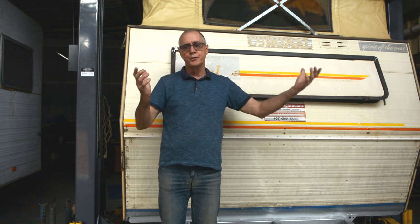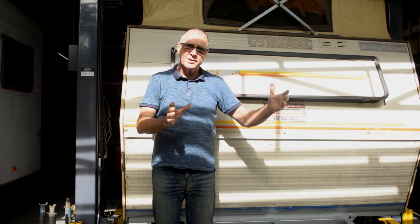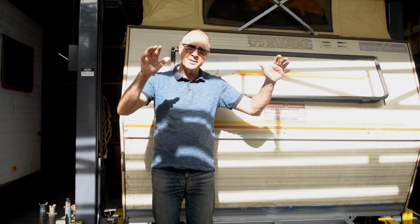In this episode we're going to look at the suspension. We'd like to put a bigger wheel in to get the van off the ground a little more for extra ground clearance. We also want to upgrade the suspension to increase the load carrying capacity up to two ton — that's going to involve a new axle, new set of springs, and 12-inch electric brakes. On the advice of the trailer parts people, we need to lift the whole van up four inches, drop the old suspension out, measure what size tire we can fit in the guard, then work backwards from there.